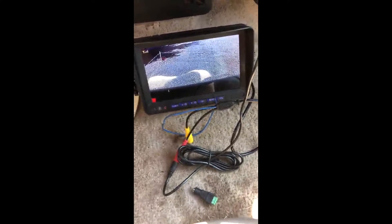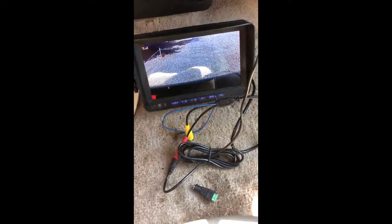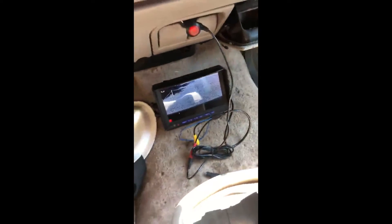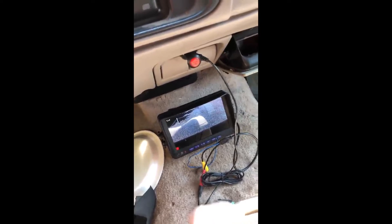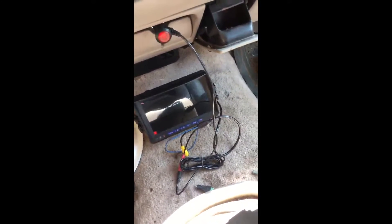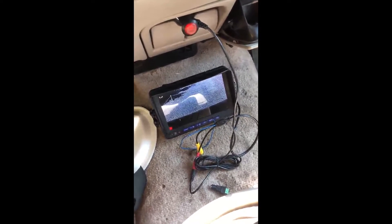That gives me a signal of the camera and what's behind there. At the bottom of the screen you can see the very top of the Suburban where the camera is angled down so I can see behind it. I'm not personally worried about having the reverse lines — I don't want them, they'll take up some of my picture. But I do like the cigarette adapter because you can control the monitor, and as soon as you put it back in park from reverse you lose the signal, and with it wired to the reverse light, as soon as I put it in reverse it gets the signal again.